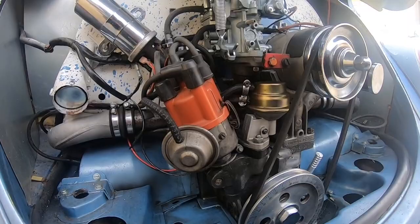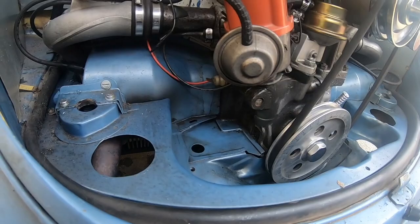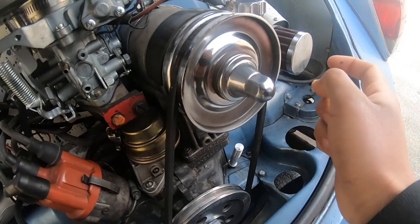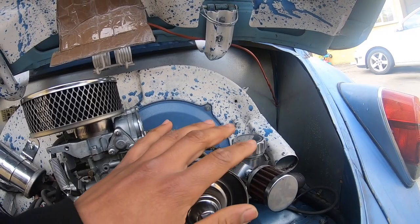Let me show you the game plan of what went down last night. I tried to cap off where the breather goes and it started spilling oil out of right there — the crank seal — oil just started coming out of literally everywhere. So I decided to put one of these filters on there. It's not the best looking but it's the best chrome one I could find — it's off my 350Z from the PCV kit I bought. Next I'm probably gonna get the one that everybody gets — it's basically a catch can for the bug, I think it's called a breather kit.